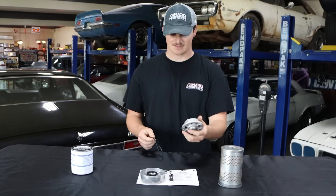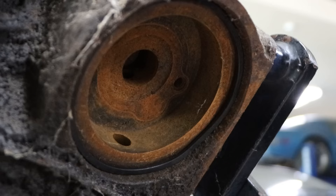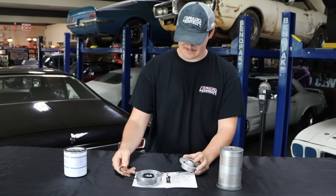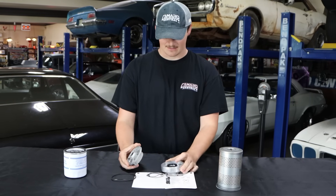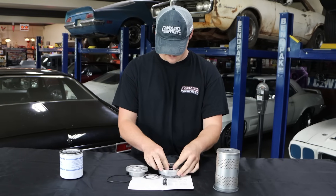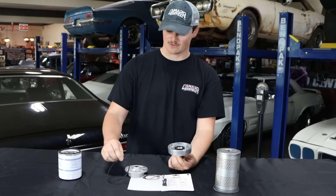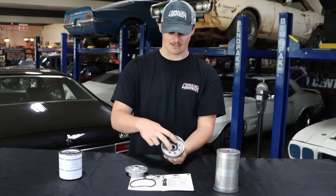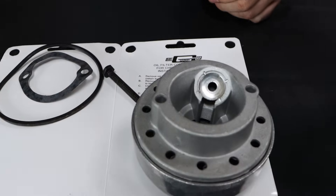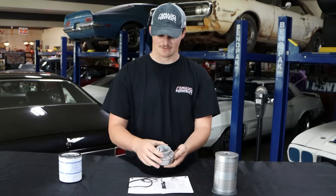The biggest thing and the first thing you want to look at is your bypass plate and your rubber washer. This rubber gasket you actually insert into your block in that valley for the oil filter. Next you're going to want to get your smaller gasket that this kit comes with and sit it on top of your adapter plate. After you've got your rubber gasket in your block and rubber gasket on your adapter plate, you're going to put your bypass plate onto your adapter plate. This is going to give you a seal in two places — the seal for your engine and the seal for your plate.